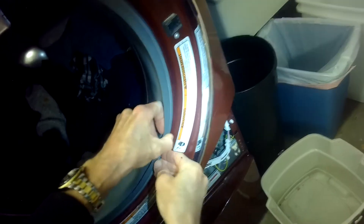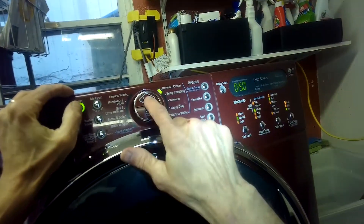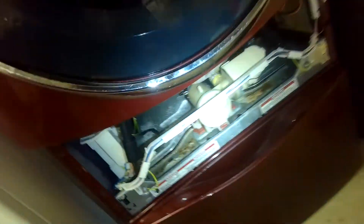We already checked on all those things, so I'm going to keep that ring off and do a test first, then I'll put the ring back on. Shut that, power it up, normal cycle, and give it a leak test. You can look for forensic evidence of where leaks are — you can see there's a little rust spot there, a wet spot where water had accumulated. Wet in here too. You can see on this aspect there's definitely some water.